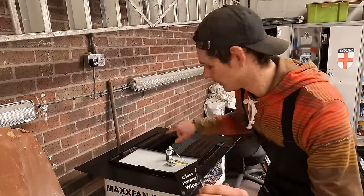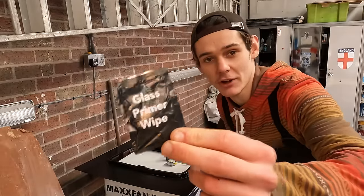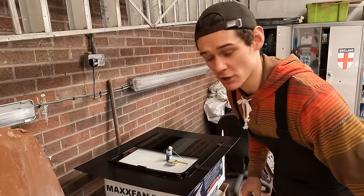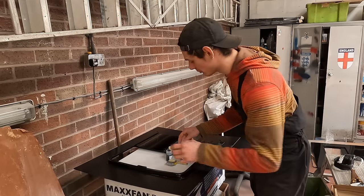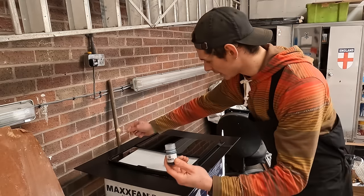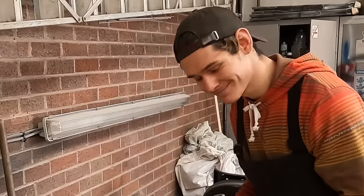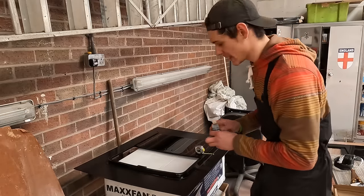I've cleaned around the glass and around the outside of the van's back doors with these glass primer wipes. All it says is let it dry, then move on to the primer — you've got these little swabs for that, just cap the lid off and dunk it. I've worked out I've got about an inch spare on the back bits, so I start painting from an inch outward.